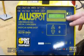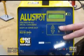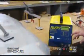Once you go over 100 volts, there's a possibility of pulling a hole into the metal, due to the fact that the base metal — the sheet metal or aluminum you're working with — thins out, so you're pulling on a pretty thin piece of material.